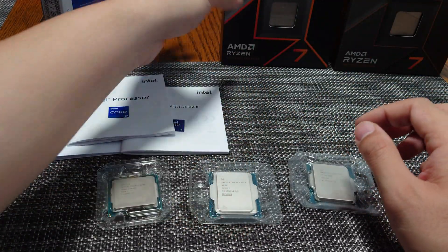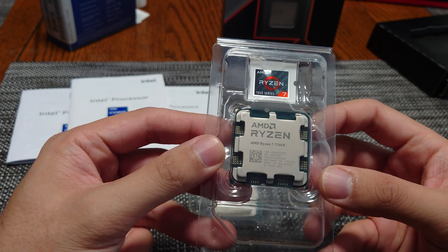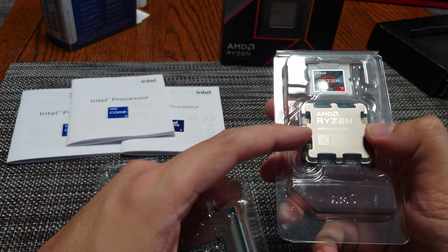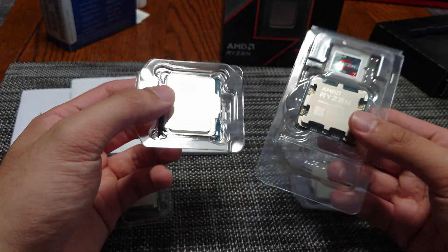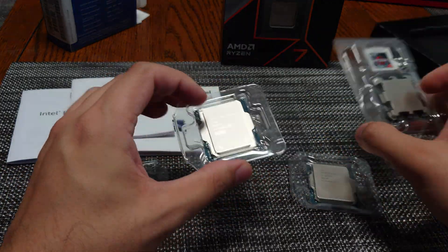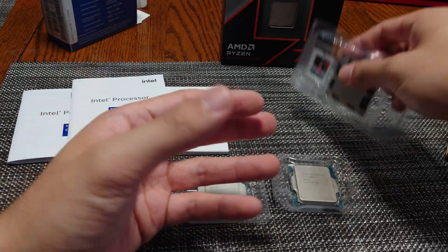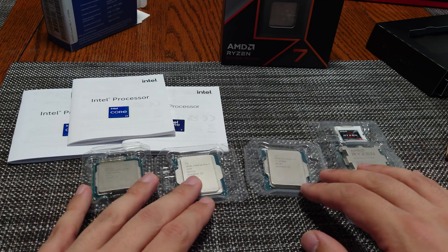Comparing with one of AMD's CPUs — that is the AMD CPU with the Ryzen 7 sticker. The SMDs are in the middle on the back of the Intel one, whereas on the AMD one the SMDs are on the front. Generally that's how they compare. The AMD one is actually a little bit heavier — I think the IHS is really thick — whereas this Intel one can be prone to the old IHS problem where it could bow inward over time, so they could benefit from contact frames. There are contact frames for the AMD one as well.